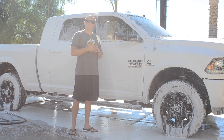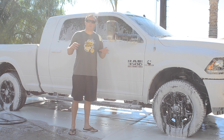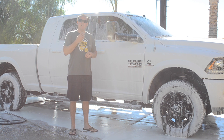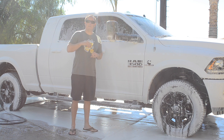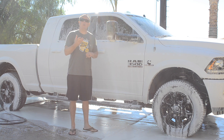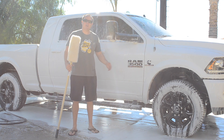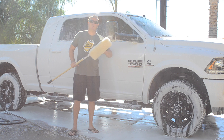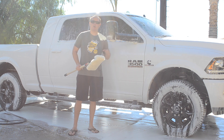A lot of people have the misconception that you shoot with the foam cannon, let it sit, spray it off, and you're done washing your car. I disagree with that. I think you need to shoot with the foam cannon and then wipe down your vehicle with some type of lamb's wool — something that won't scratch your vehicle. It's been about five minutes, so I'm going to take my lamb's wool and go over the vehicle, getting all the hard dirt loose before I spray it off.